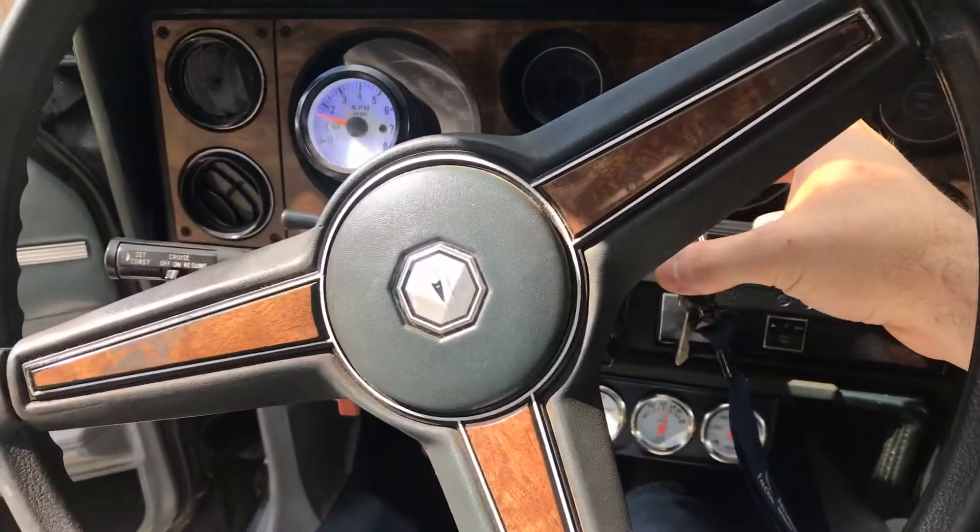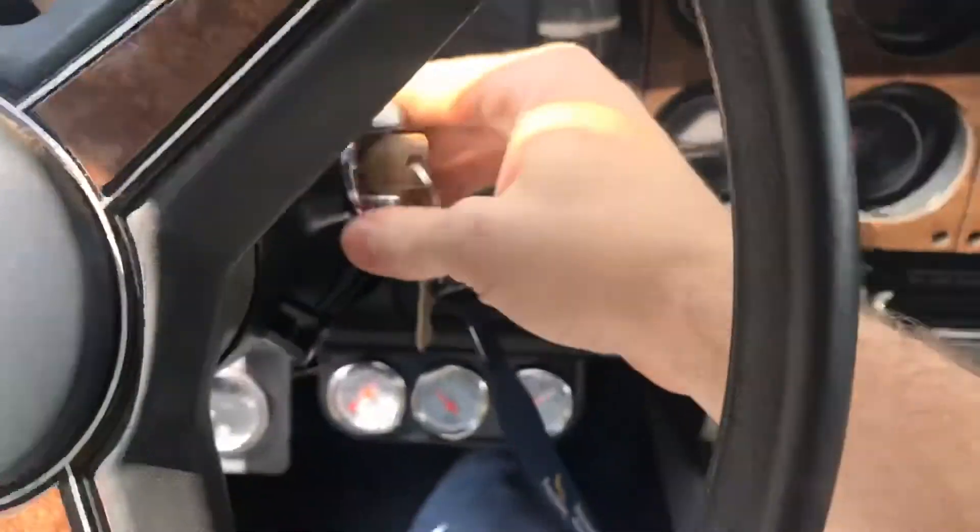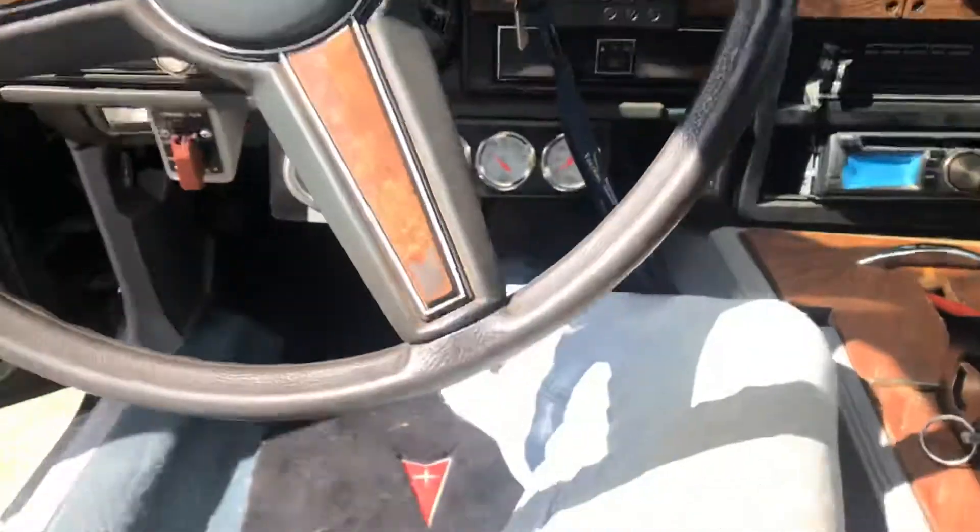Let's go ahead and kill it — kill the battery, relay open — and you can see, again, nothing. In my opinion, that is just so much easier than getting in the car, popping the hood, reconnecting the battery, or turning the big red key. So that's my little thing I came up with. I'm sure a lot of people have done this, but I didn't really see anyone doing it. So if you want to do this: get some wire, get a pigtail, get an RV latching relay or anything that can handle the amps, and a toggle switch — and you'll have yourself a fun little battery disconnect and an easy ride. I'll see you next time.